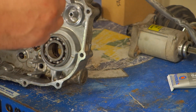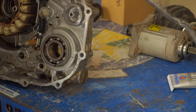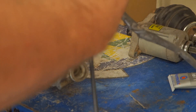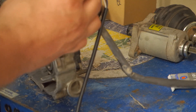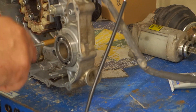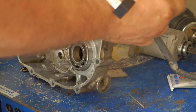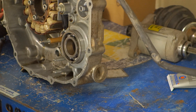They're big in the motorcycle scene to get your speedo closer to actual real readings. It kind of goes like all the Power Commander connections — you just hook this in line to your pulse sensor off of that gear, and this one will go to the factory harness. Zip tie it up out of the way and program it.